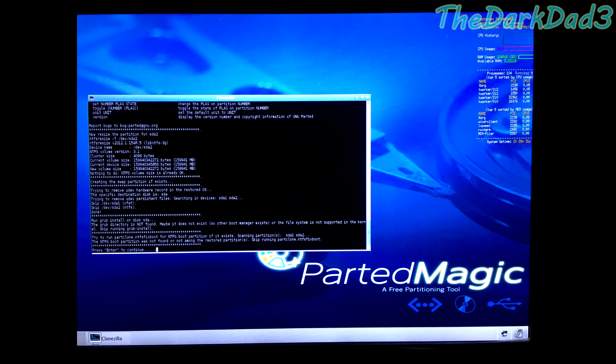Hey guys, it did work. The program I used was Hiren's Boot, version 15.2 or 15.1 — I'll check and put a link in the description. I used Clonezilla, which worked pretty well. What you're looking at is basically a success — it copied the whole drive and placed that exact same image onto the new Crucial SSD. One thing to note is that when it made the partition it did not use the whole space, so I had to create a new partition using the rest of the space and just labeled it extra storage.